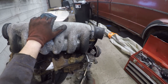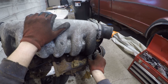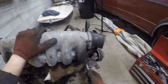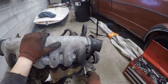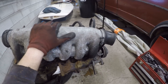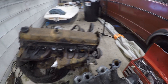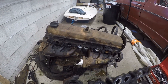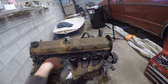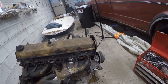At this point I'm hoping just the very end, cylinder number one, got water where the intake is. You can see on the right there's a hole — some rain might have got in there — and I'm hoping it's just that first cylinder. And off it comes. We have a bit of fuzzy aluminum corrosion there but it's just powder at this point, nothing to worry about. Cylinder one is the issue.